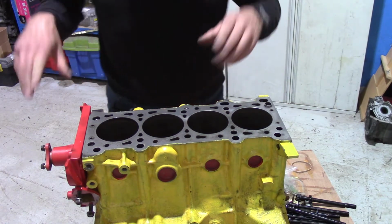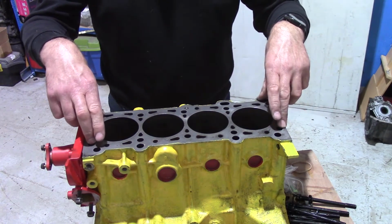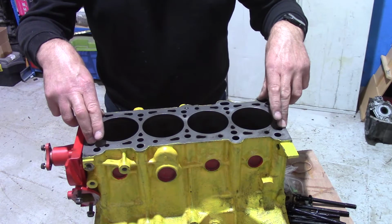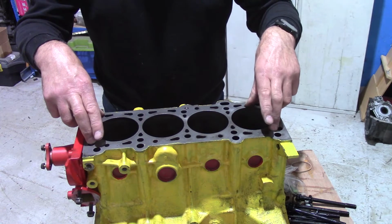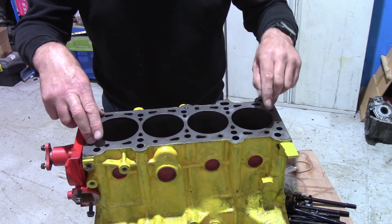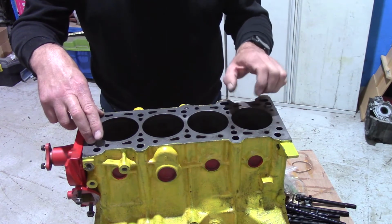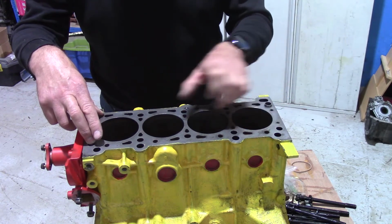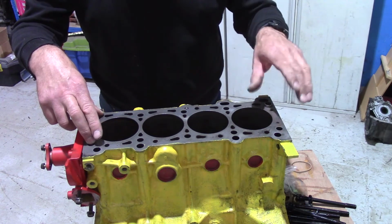The truth of it is, the company that machined the bores for me took one of the pistons as a sample and made the bore's diameter to match the pistons to give the relevant clearance. So the fact that it's 0.04, 1.6 thou, bigger than the 84mm doesn't bother me in the slightest, because they've matched the bores to the pistons, rather than just blindly going and saying 84mm.